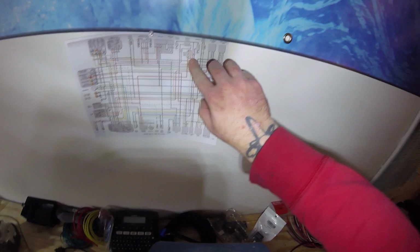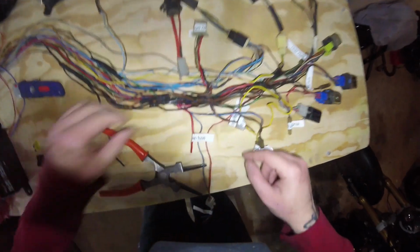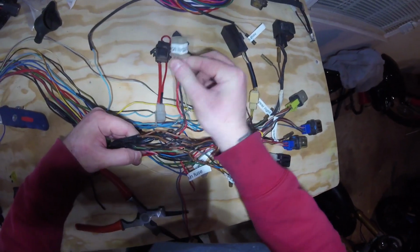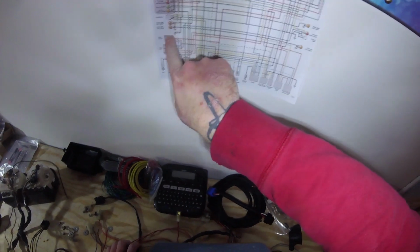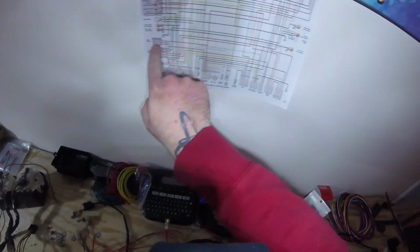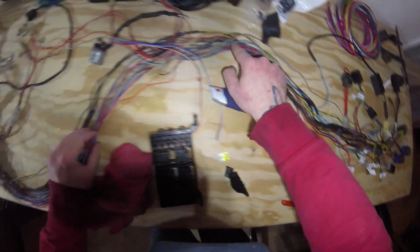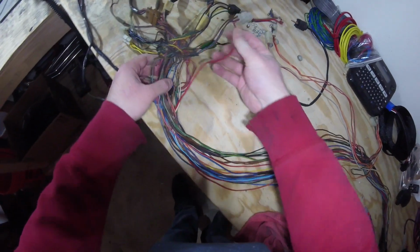And then off the main fuse, you can see where it comes down into the rectifier regulator, which you'll see mimicked here from where this main fuse is. You'll see this first joint, and this actually goes off to the plug where the voltage regulator was. So there's that first joint going down there. The rest of the wire, once you hit this joint and continue going up, ends up over here at the main switch. So you'll see it come down here from the main fuse. Here's the joint off to the rectifier, and then the rest off to the main switch. So basically this whole thing snakes up through the wiring harness, comes up here, and eventually boils out to this. So this is that wire.